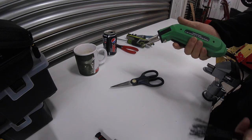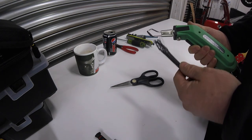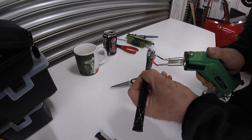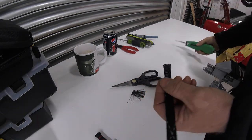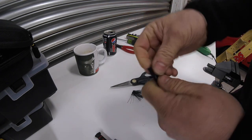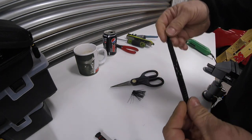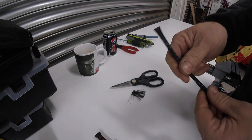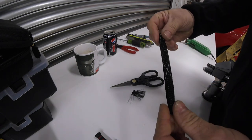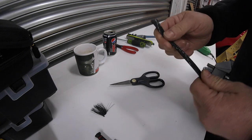I use a hot rope-cutting tool - anything that heats up works, even a lighter and a knife blade. What this does is just heats up so we can trim the braid and seal all the filaments over the end. That way it stays nice and in place instead of unravelling like it would with scissors. Cut your braid with something hot. I know quite a few people only plan on making one or two looms in their life, so a hot blade with a lighter will sort it and makes such a nice job compared to scissors.